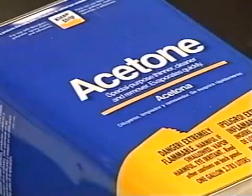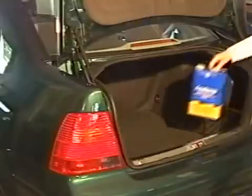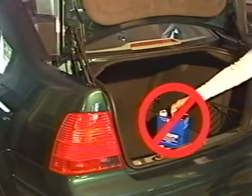Your injector should be cleaned with acetone at the end of each day in preparation for the next day's repairs. Acetone can be purchased at any hardware store and is reusable for 10 to 20 cleanings. Your Tri-Glass windshield repair kit does not come with acetone because of flammability. Stay safe by storing your acetone in the Tri-Glass acetone storage jar. Do not tip over, and remember, acetone should not be carried in your vehicle.